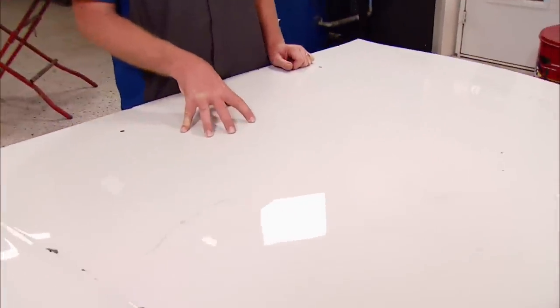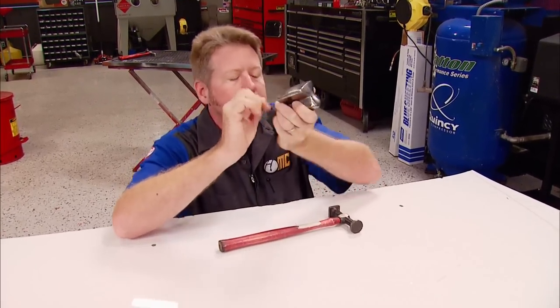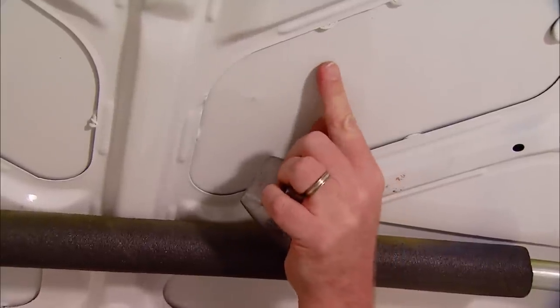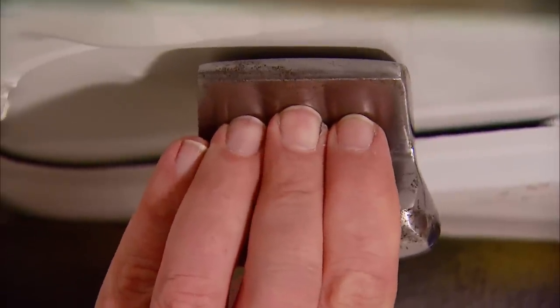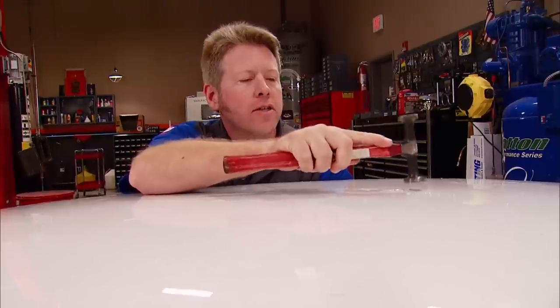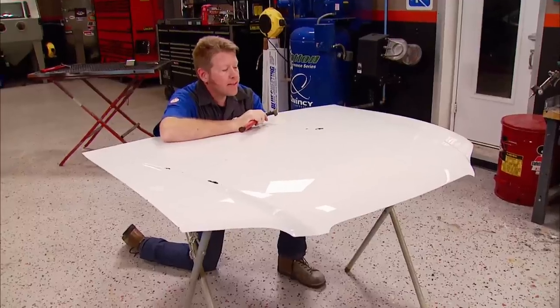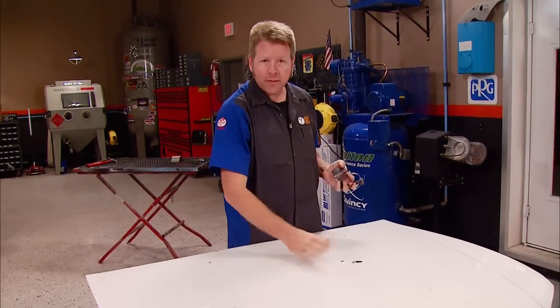Keystone Automotive sent me this hood that I can use for demonstration purposes. I'm going to show you how to fix a dent in a flat surface and in a curved surface. We're going to hit the flat ones first because they're pretty simple. Get your dolly — you're going to use a dolly that has a rounded face on it because it's a lot easier to use. On the back side of the panel, find where the tip of the dent is, put your dolly on there until you can just feel it rocking. With a little bit of pressure on the back side, real easy, start working it up. Don't start smacking it because you'll stretch it out and make a bigger mess. You want to hit from outside on the high spots. Little dings like that are about as simple as they get — sand it out, put a little bit of primer on it, block it, and you're good to go.